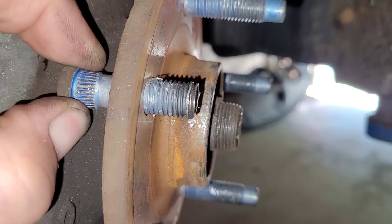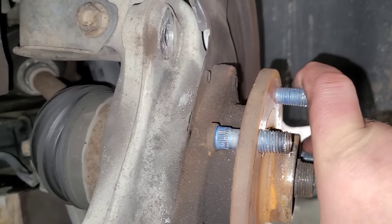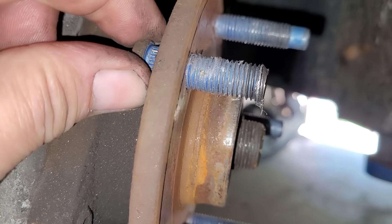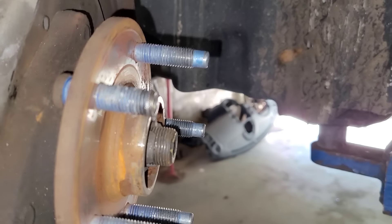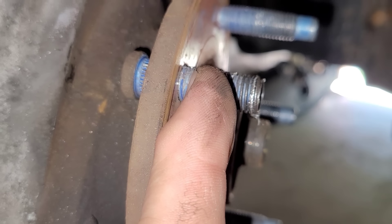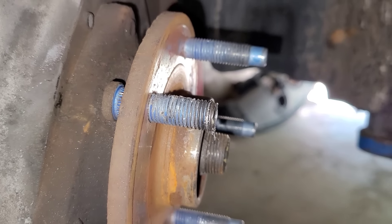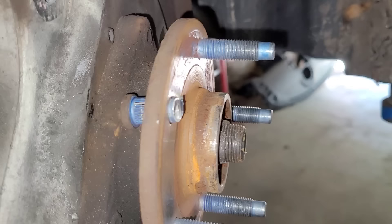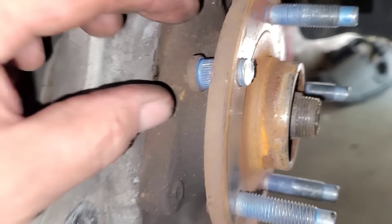Here's an issue — it won't come out. You can try hammering it out, but it's not going to come out. You get it to that point and it's still hitting there. So what do you do? I'm going to slice this in half so I can get this thing out. You can take a Sawzall, a hacksaw — I'm going to take a cutoff wheel and just slice it off. I'll use my cutoff wheel, cut that down, and now that should pop out.